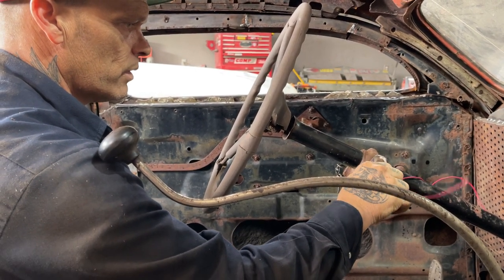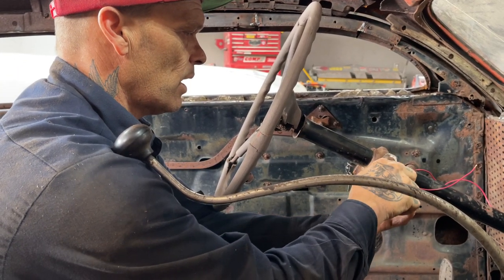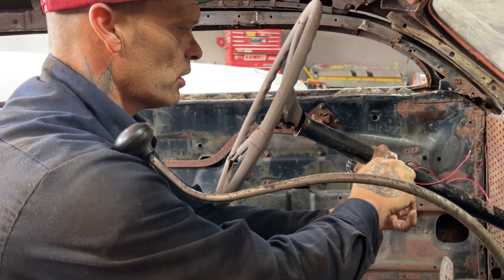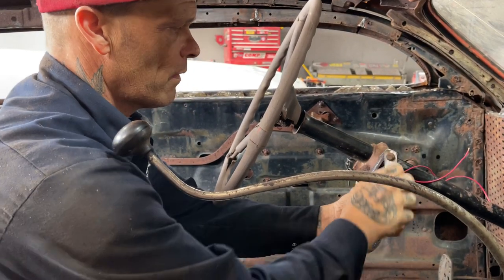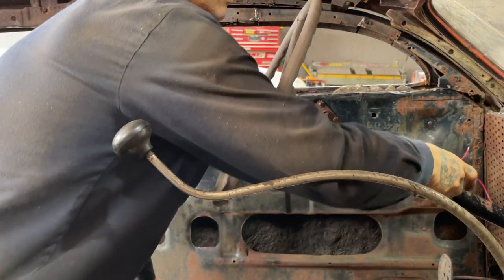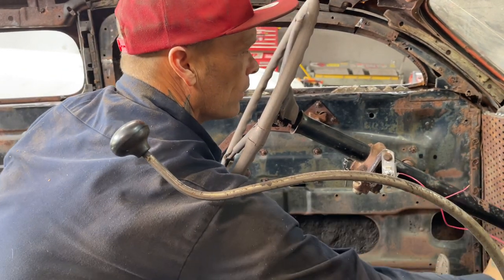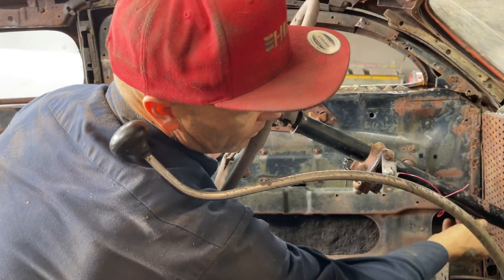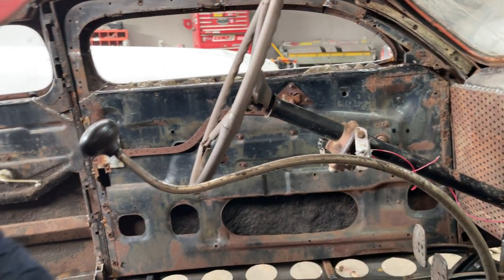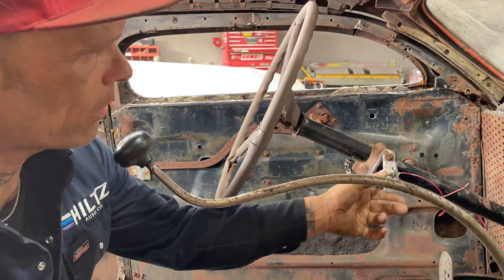There's your safety switch right there. Well, not safety switch, your off and on switch, I guess, but if you had any problems, you just reach up there and turn that off, your engine turns off, and then we just go from there. All right, we're on, off. All righty, we'll get that down into there, off that metal. You don't want to run any wires on the edge of any sharp metal at any time. You'll cause yourself an issue. We've got an off and on switch there now. On.